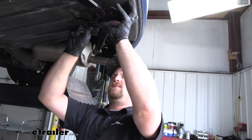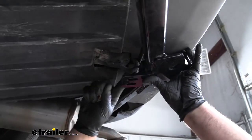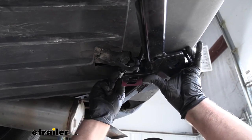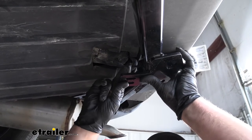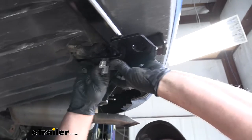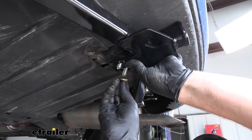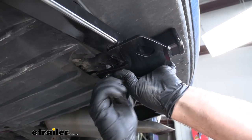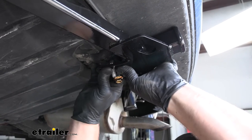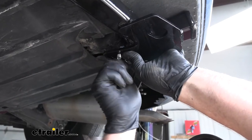As you can see right here, there's a little tow hook. The kit's going to come with a U-bolt that goes around like that. We can line that U-bolt up with the holes in our hitch and loosely secure the nuts — it's just two hex nuts that go on it. Once you get both of those started, that'll kind of help hold the hitch into position.